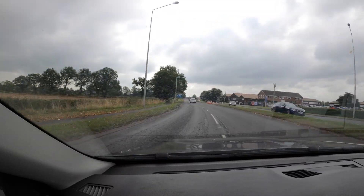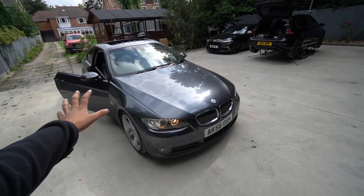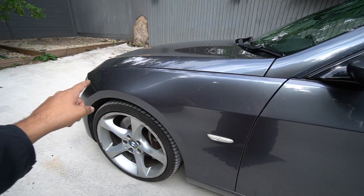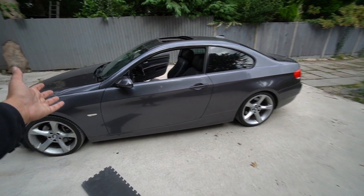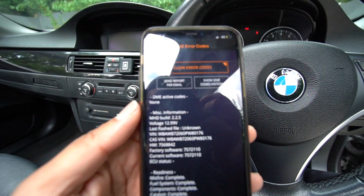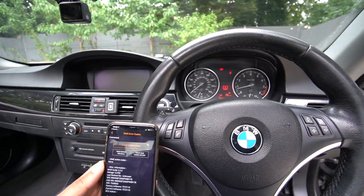Just as I ended that - can you hear that? There's some weird noise. Something's fallen off. We managed to make it home in one piece in the 335i - it literally sounded like a steam train going down the road. I've identified the culprit for the knocking noise: the under-tray is pretty much hanging off - the middle section of it. I'm guessing when I took off the front part it loosened that section and I haven't put it back on properly. Minor mistake really - I'm glad the main parts of the car are fine, the engine and gearbox. Just a few screws and we're good to go. Little taster of the upcoming videos: scanning the car with MHD - a tuning platform for these BMWs - and it's saying DME active codes: none. The 335 is all sound as long as you put your under-trays back on properly.